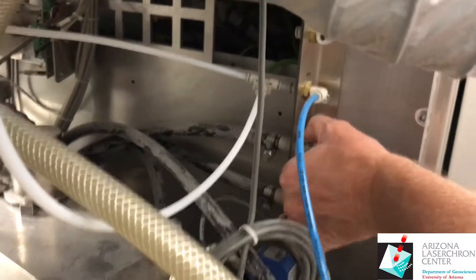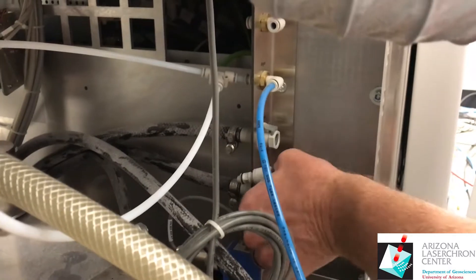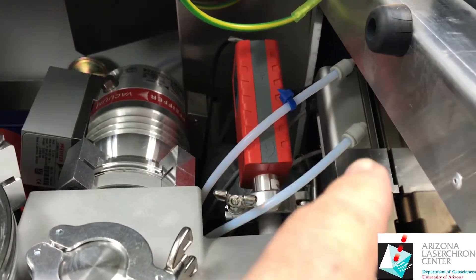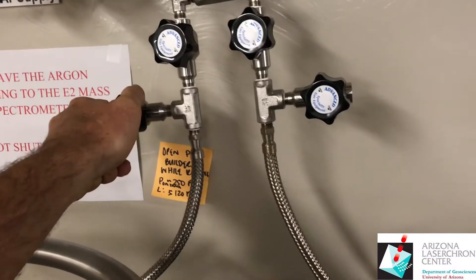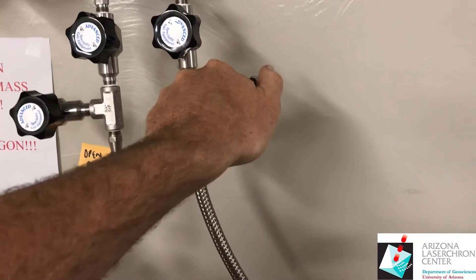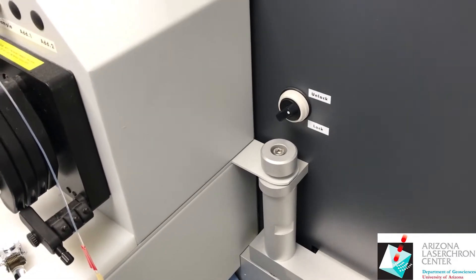Disconnect the water lines. These have inner valves so they're not going to leak much. Leave the argon before we release those two gas lines. We're going to kill the main valve now — this thing has not had the pressure builders on. Bleed the mains. We could toggle the lock and unlock to bleed, but we've already done that for this.